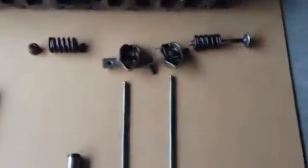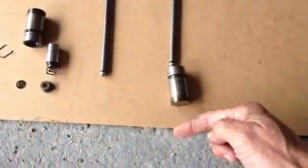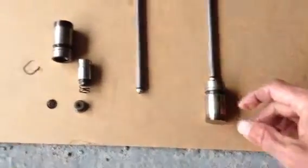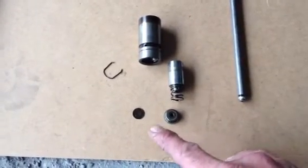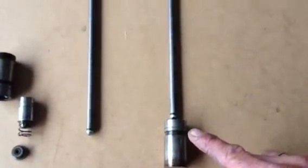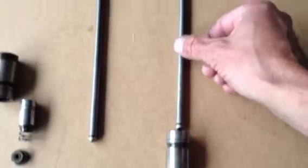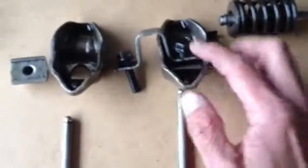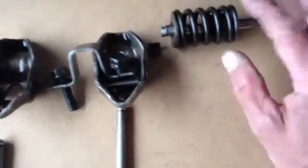Then all of the mechanical and hydraulical parts. It starts from here, where you have the camshaft running, touching the hydraulic tappet. The interior of the hydraulic tappet you can see here — that is the tappet, that is the plunger, and that is the regulator that is fixing it inside. All of this I've cleaned. So this is hydraulically adjusting the clearance. Also make sure that the push rod goes up, touches the rocker arm, which is fixed by this bridge on the cylinder head, and on the other side, operating the valve.